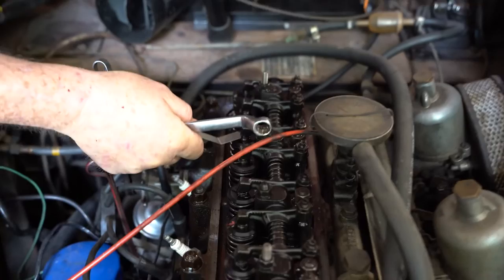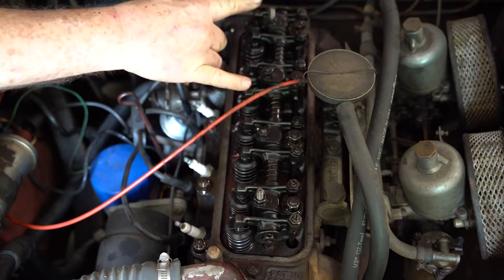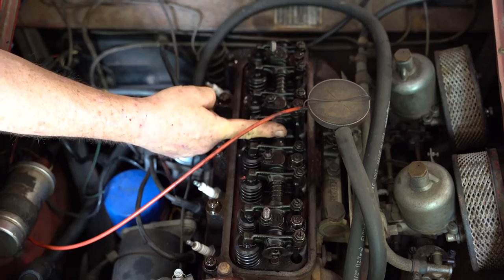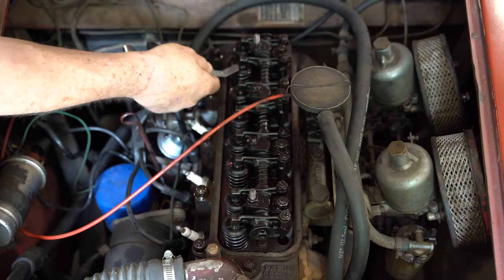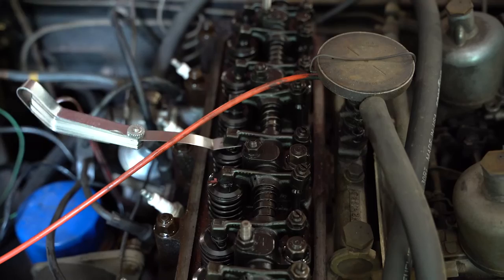Those are done. And our last two, the opposite of 2 and 5 is 4 and 7, based on this imaginary mirror center line. So 2 is open. We're going to adjust number 7. He's all right. We don't have to adjust him at all. Number 5 is open. And number 4, oh, it's a little tiny looser than the rest.